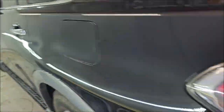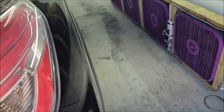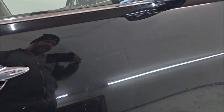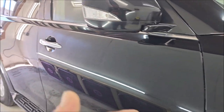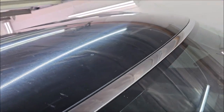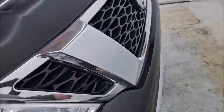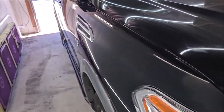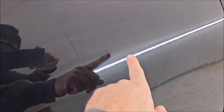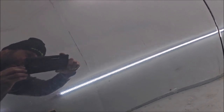The reality is I can position this thing where I could paint all the way around it and still shut the doors. Look how bad this paint is — it is just hammered. I'm going to be using the new Go One Step polish on this thing, and it's getting a one-step polish everywhere except where I'm going to paint. It's also got a bunch of love bug etchings on the roof, but for what I quoted him, I'm not going to be able to do anything extra — there's just not enough meat on the bone. I'm probably going to do a couple of polishing test spots to see how I can get this to look.